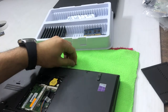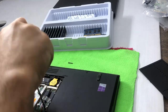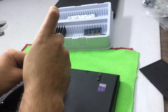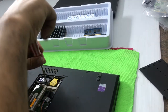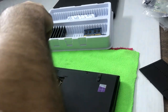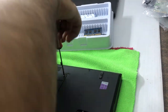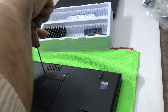Now I have to put back the screws, then I'll show you how to install the hard drive. This laptop had a 500GB drive — I removed it and put an operating system on it, and I'll put it back to show you how to remove and add a hard drive in the T430 or older T series Lenovo laptops. Just be careful with the clips — don't break them.